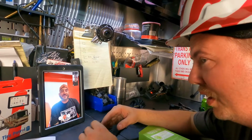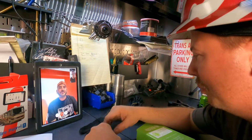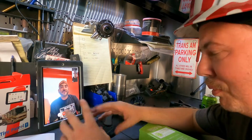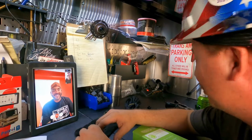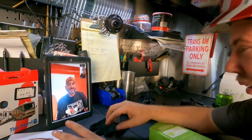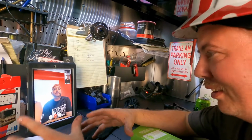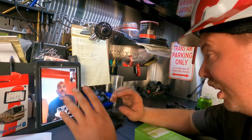It also let me know that there's a lot of fuel there because it was rolling coal. So once we put the nitrous to it and get the air fuel back, we probably have 150 horsepower worth of fuel that we can burn before anything dramatic happens. So I think it's going to make some really serious power here in a few minutes. Dang, that's gonna be impressive. Yeah, it already impressed me because with like a 10-to-1 air fuel ratio, it still made 183, 184 horsepower, which is more than anyone thought it would make on a good tune-up.